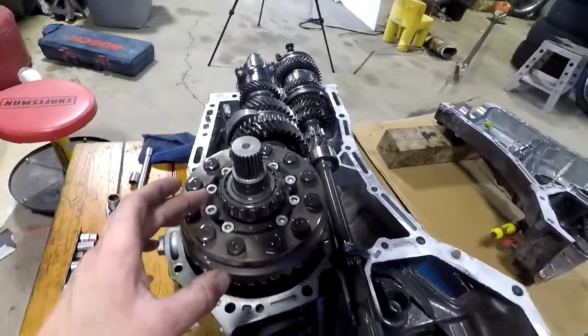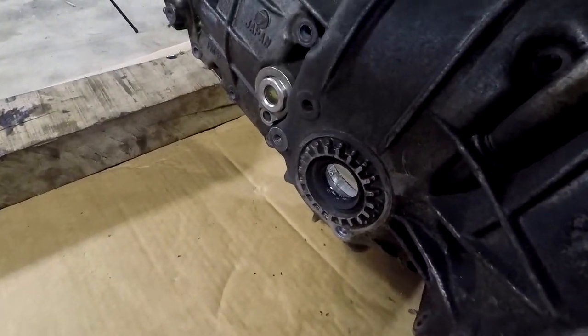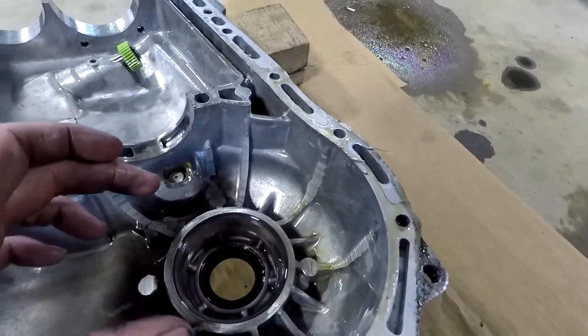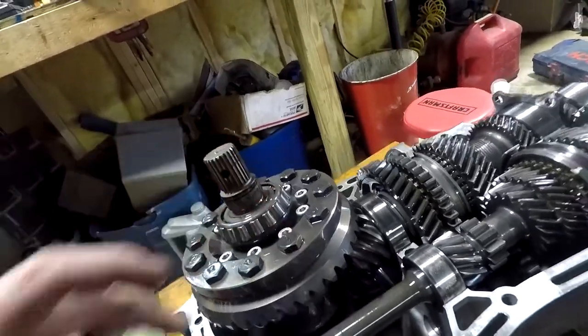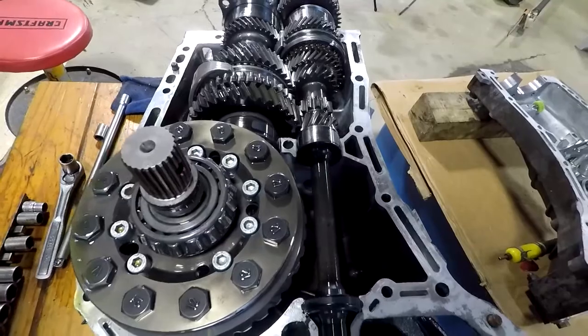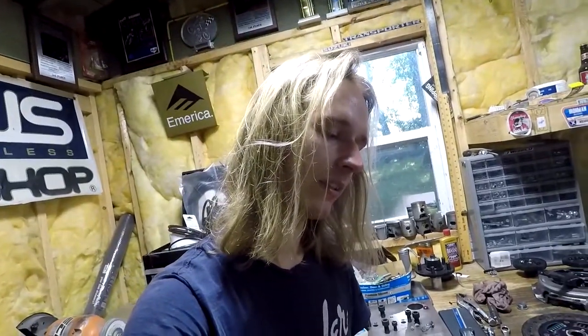There are tensioners that press these cups in. This is a threaded piece - that star is a nut - and this bearing race just fits in that bore and can slide up and down. That's how you set your tension between your ring and pinion. If you tighten this nut it presses on there, and I started tightening that nut and literally this thing popped right apart. You have to use mechanical leverage, and I was able to access that by tightening that nut because it pulls the cases apart and you hear it kind of pop apart.